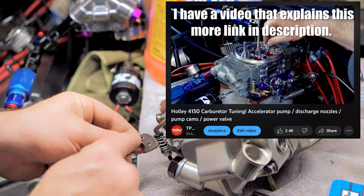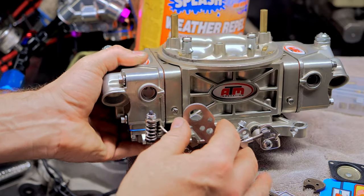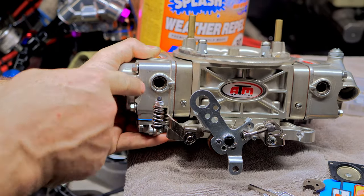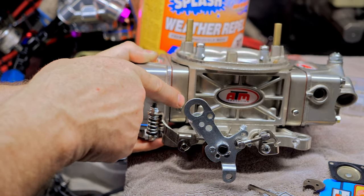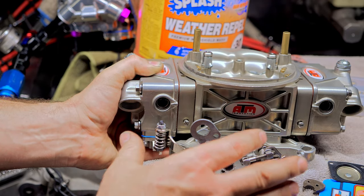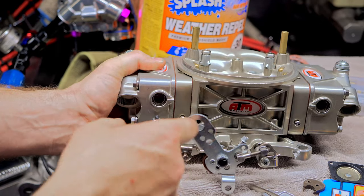But this is gonna squirt fuel into your motor, and that's very important because of the way this works. If you do this really quick, the motor vacuum has to happen in these carburetors, right? So it has to pull the fuel in your bowls to your main jets, all the way up, and then out your boosters. But when you crack into it, it's way, way, way too fast, right? You'll have a whoo, and then it'll pick up. Or it might pop through or backfire. I mean, who knows? It can do all types of bad things if this isn't set up right.